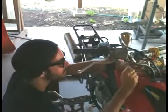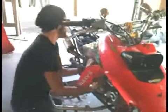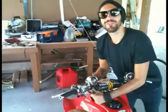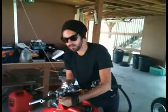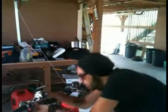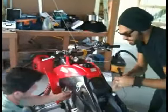I think all we have to do now is start running our wires for the battery and the speakers all together. Right now I'm just running the wiring through the frame — from the handlebars back to the mini-amp over here. Run it under the frame, by the gas tank, and out over here by the air filter so it's ready to plug in. Next, we're going to plug the wires into the wiring harness. Remember, your black is your negative, red is your positive — match them up real simple, real easy; they just slide right into place and click in. Now we're running the other side — Sequoia's running it under the frame, under the body panels. I'm putting on the last of the zip ties here to the handlebars. The zip ties do come in the box, so there is nothing needed outside of the box to purchase. We decided to mount the volume control right under the speaker — it's a nice spot for easy volume adjustment while riding, right next to your grip.